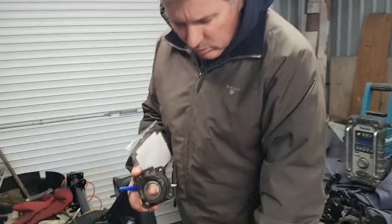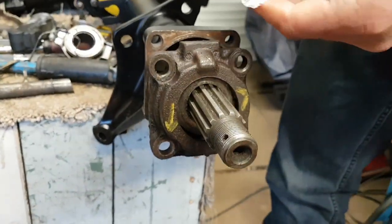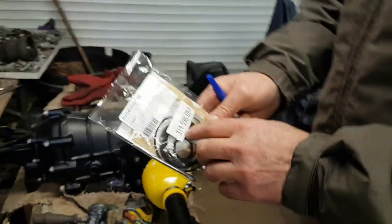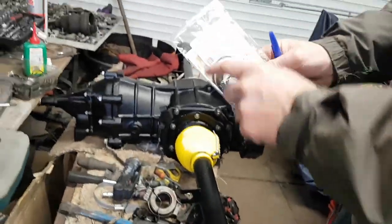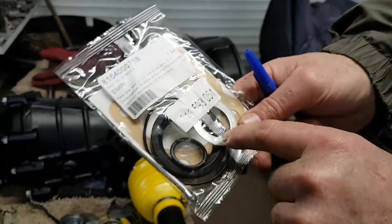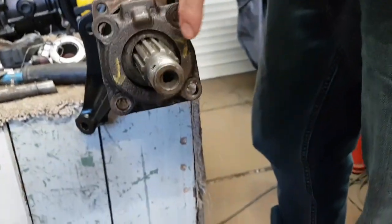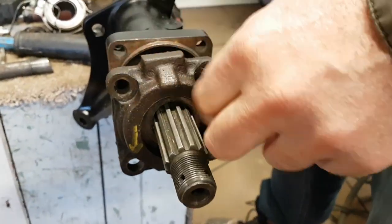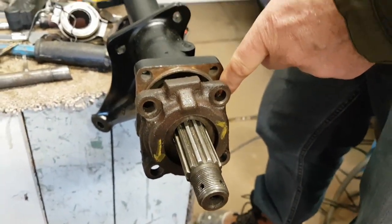These are the axle end bearing ends, and these are the caps that go inside — it goes in there — and we have the backing plate in there. I bought these kits; there's the part number. One kit from MP, one kit per axle end. So you put two of the packers — that's a shim — and two o-rings for in there, and one main seal. I'll clean all this hub up and paint it. I've got to clean the rust off that one; I've cleaned the other end but not this one. And then I can start putting the brakes on.